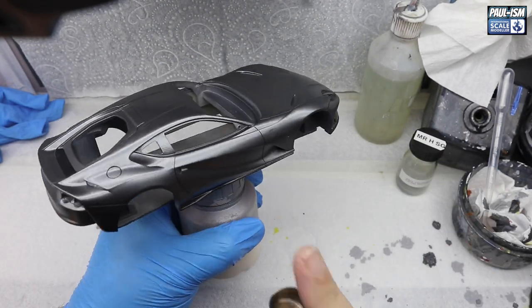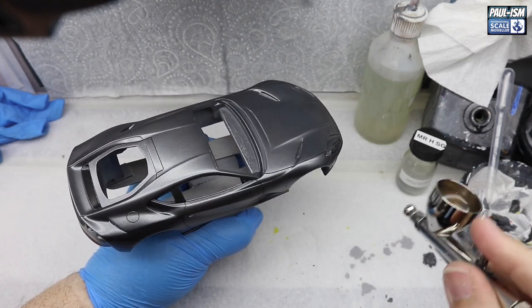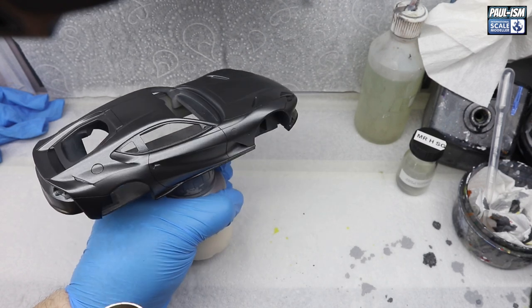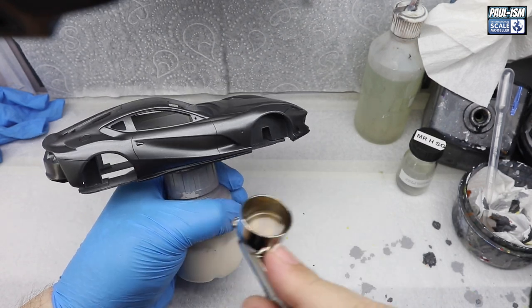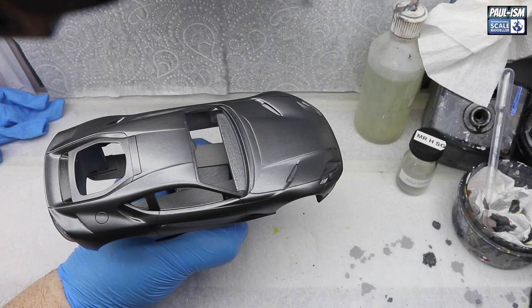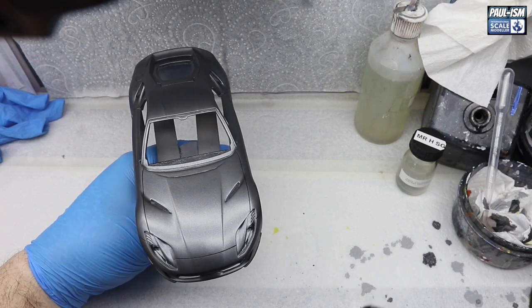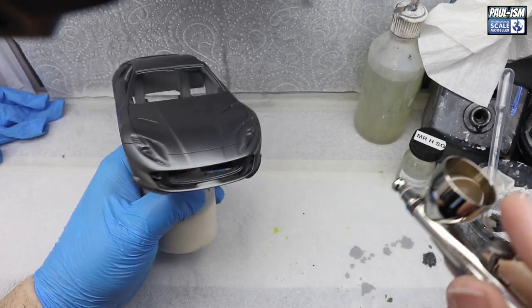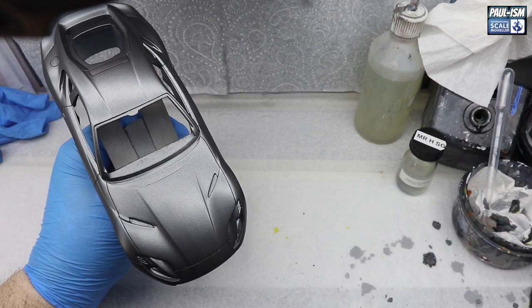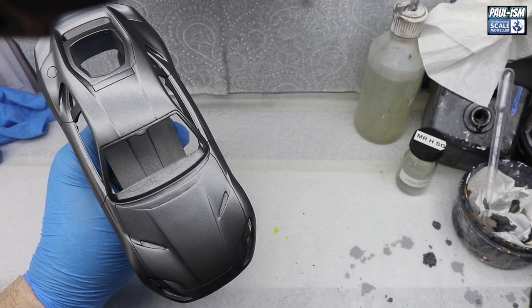So go over the anti-static brush. I'm just going to put a couple of light coats down. One little bit of fluff there. But thankfully, we didn't get anything else in the finish. Much easier than 2K. It's nowhere near as sticky and gloopy. So there's not as much opportunity for me to stick in it. But just a couple of light coats going over, you can just see the metallic finish just go satin, and it's a nice uniform satin as well, so it gives us a nice uniform finish,